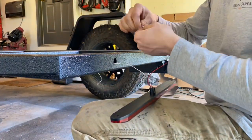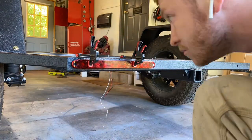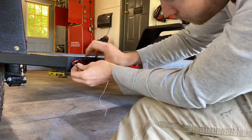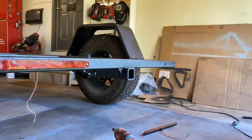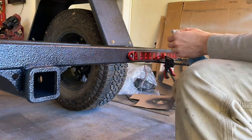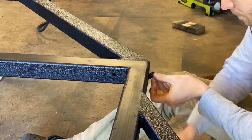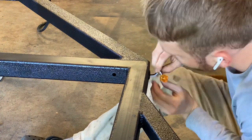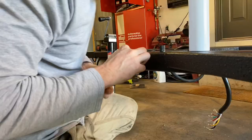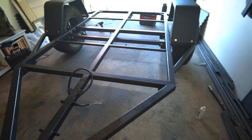For installation of the rear tail lights, I'm placing them where they're going to go, making some marks, and using self-tapping screws to hold them in place. Once the holes are drilled, I pull it back off and run a bead of silicone around the stem and around where the screws will seat, then screw it on and run a bead of silicone around the whole edge of the tail light to make sure we don't get any water intrusion. The front is the same deal — add silicone to the gasket that comes with the light, put it in, silicone around the light, slip it into place, and wipe up the excess.